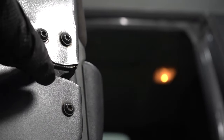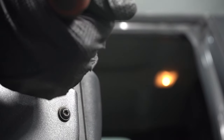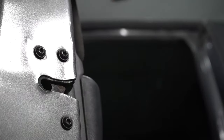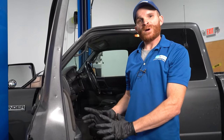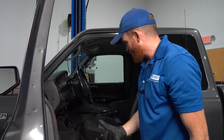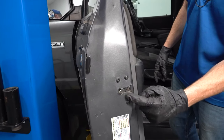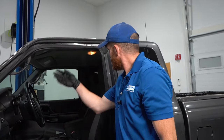It must have an issue with the switch located inside the latch. The way you can tell if you have a latch switch is if you come right inside here and pull on it — that's going to essentially tell the door it's in the shut position, and that should also tell the dome light to turn off. Whether you have the push button switch or the door latch switch, if it isn't working and not making your dome light turn off, that's telling you you have an issue with the interrupter that's part of the switch. If you test it by pressing the push button and the dome light turns off, or you latch it in with a screwdriver and the dome light turns off, it just wasn't working when you actually shut the door.